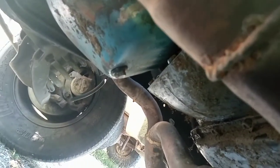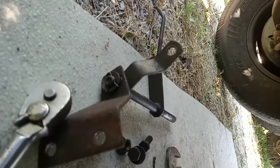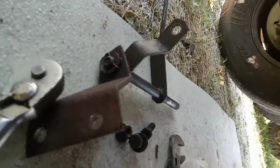Let's keep going. All right, fellas, one step forward, two steps back. Chrysler, sometime in the late 80s, decided to add an extra boss to their transmissions. You can see that one that got sliced up there. That's what was keeping me from getting it planted easily yesterday. I was messing with the kickdown, and it turns out it was hitting it and not letting it go all the way forward. So I just took the 4.5-inch grinder and did the best I could. You can see here's the little bit I cut off. But now the kickdown clears and everything, but I had to pull the shift linkage and stuff off. So yeah, one step forward, two steps back. But I'm going to button this stuff up, and we'll get to putting the core support in there.